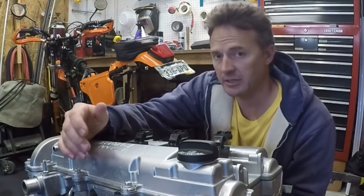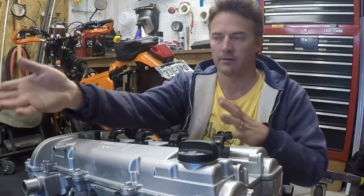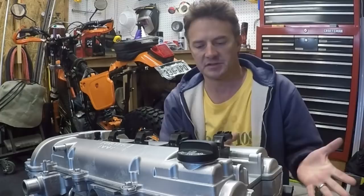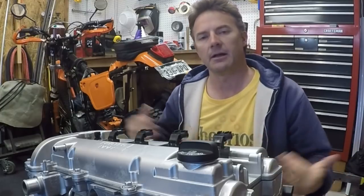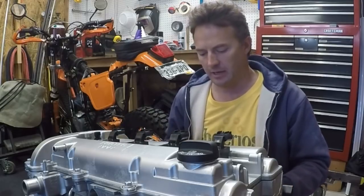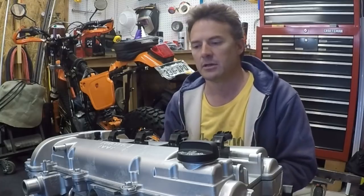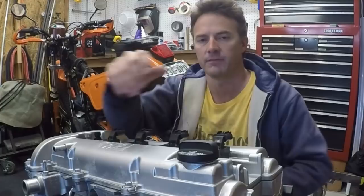The next thing I'll need to do is build a new rear cage for the engine. Once I have it hanging off the transaxle, I'll fabricate a nice rear engine cage to protect it. I'm also going to incorporate motor mounts onto that rear cage to help support the weight of the engine so it's not all just hanging off of the Volkswagen transaxle.